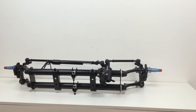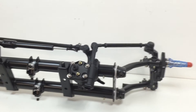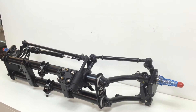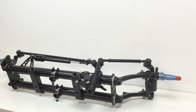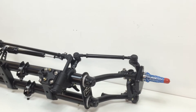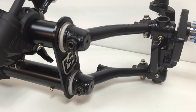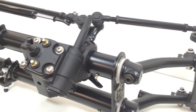Here we have our pro-built shockless beam for a link pin application, six inch narrowed, equipped with adjusters we call game changers — 7.25 inches of adjustability. Comes with Delrin bushings, brand new Volkswagen of Mexico torsion leaves, and a pro-built steering box.